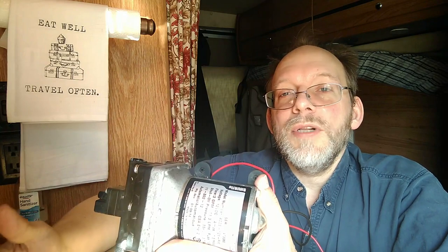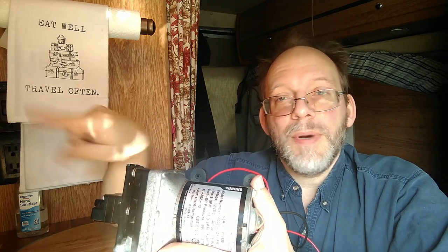The water pump will actually suck water up the hose in order to get it into the pump and pump through the systems. Of course, that's not necessary in most RVs, because the water tank is actually level with the pump — gravity itself will get the water to the pump. But the problem is, even though it's the same pump, I can't take my existing water pump out to fix the shower drain, because I kind of need both of them to function in order to take a shower.